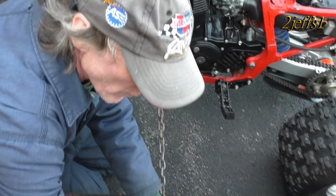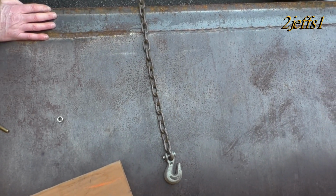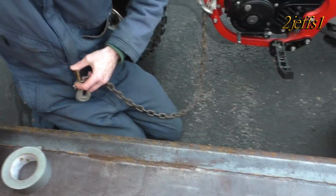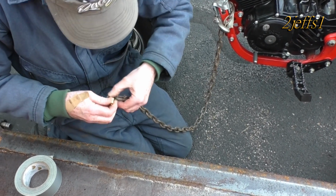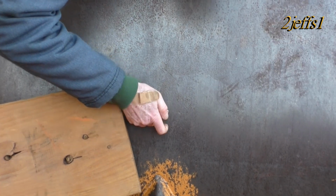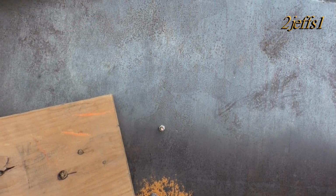Okay. Now this has got to, like I said, it's got to go underneath here. So we got a down pull, and I might have to slide the front end over even just a tad more. There, now it should reach. So I'm going to go underneath here, and I got two 4x4 blocks under here in case the hydraulics would fail, so the bucket don't come down on your hand. There. No. This has got to be as low as possible. This one, and we got a grade 8 bolt here that I'm popping on for that. There, takes care of that.